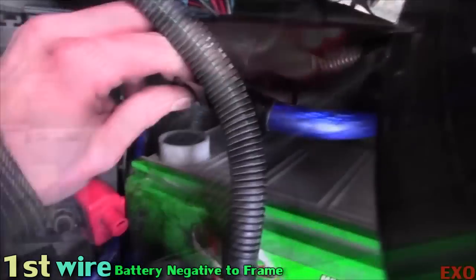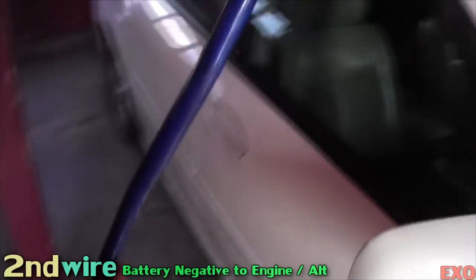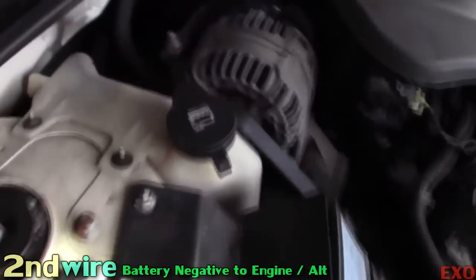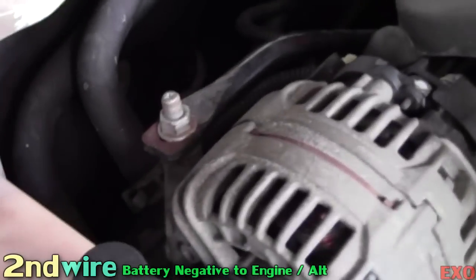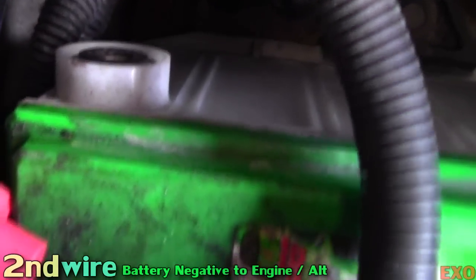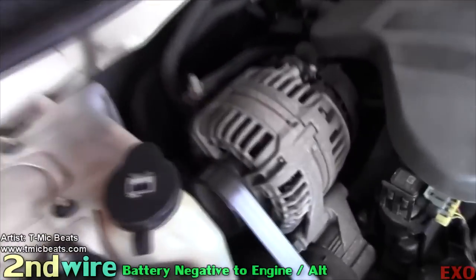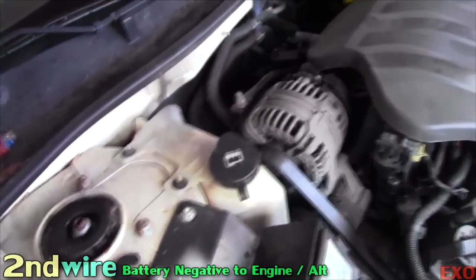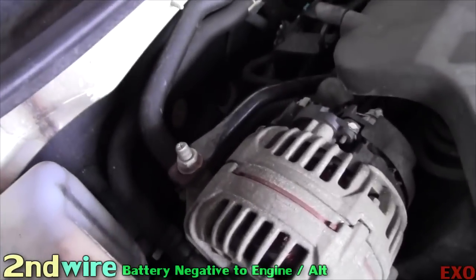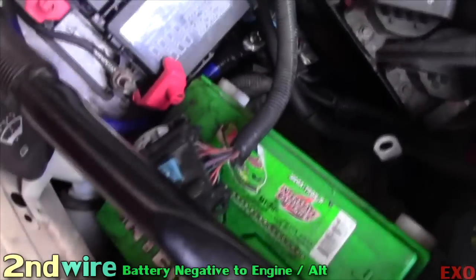She'll fit right nicely onto the post. The next wire we're gonna do is the second-to-longest one — the second ground from the post on the alternator, the negative post right there, all the way to the negative post right back down there. Our second ground wire is all taken care of. She's ready for us to take that little alternator bolt off. We're gonna take this bolt off right there, then we'll have the second ground wire all complete.